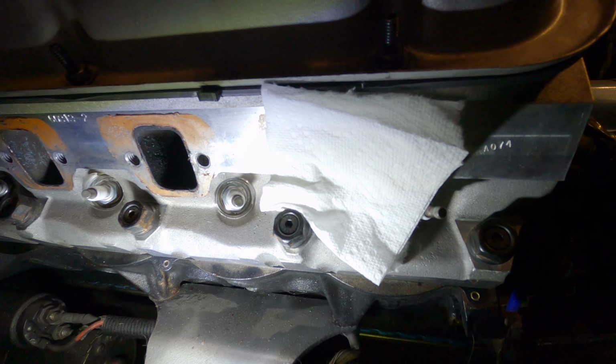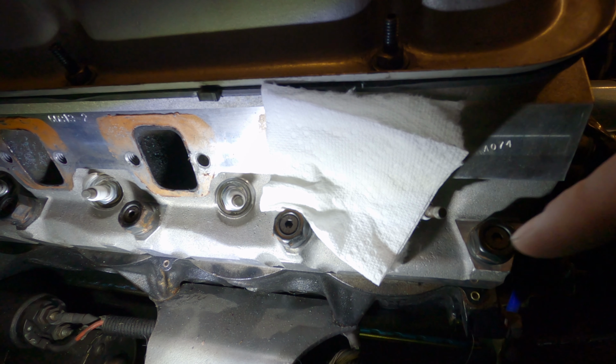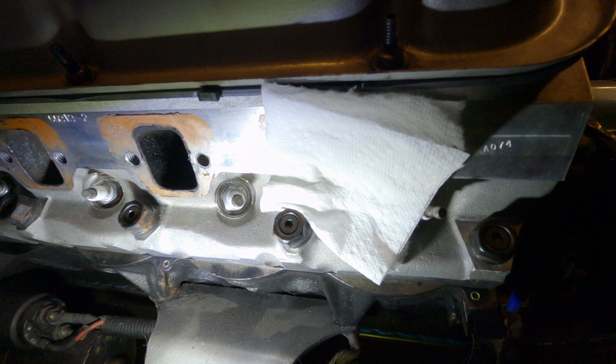There's almost nothing that's readily available that will actually dissolve it. But one thing that RTV doesn't like is gasoline. So this paper towel right here on this port is actually covered with gasoline. It's been sitting there to soften it. It causes it to swell, basically. So there's a little bit of RTV left there.